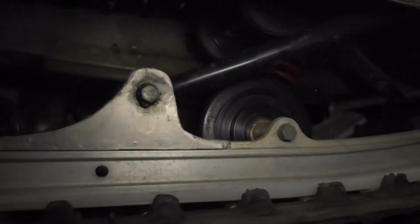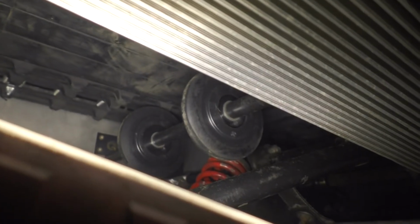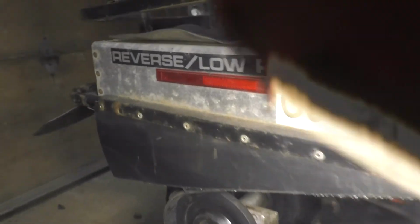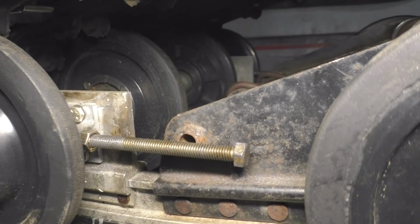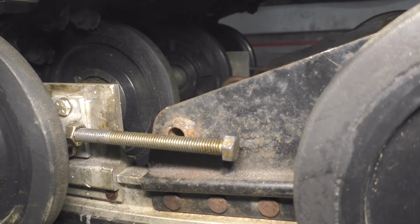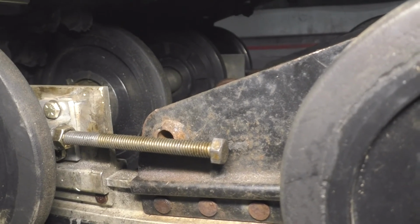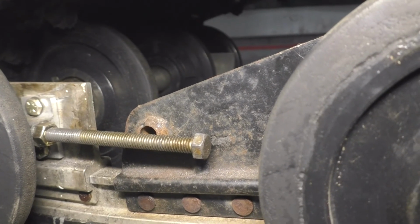It's those idler wheels right there, which with it up in the other holes, it was pushing it up against the top. I mean, it is a 154 instead of a 156, but there's the stretching as well, and you can see the anti-seize on the bolt from where it was at with the other track, and that track wasn't even this tight, so it was run all the way out to the end of its adjustment and couldn't get it this tight.